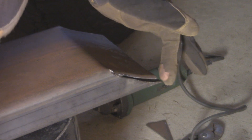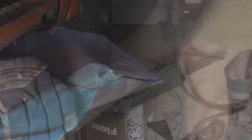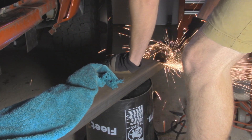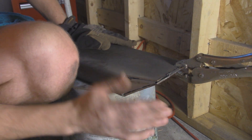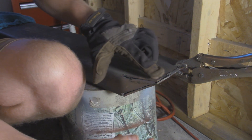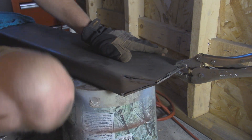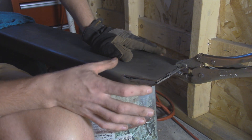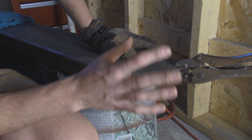Alright, so I got that hammered down most of the way, and we just have a little bit of a lip right here — probably 3/16ths of an inch on this bottom side. So we're going to cut that off flush with the end of here and then we should be able to kind of tack these two pieces together. When I do this one cut over here, it's going to make a couple lines to cut out the top and bottom, and this little corner piece is going to fold in like so. I got this little corner piece kind of notched in — I basically went an inch from the end over here and just kind of cut out this triangle that's on the top, and then went in an inch and cut out the triangle there. Just made a straight line, then I was able to take a hammer and it bends right into place. There are a few gaps, but we'll massage the metal getting this all into place. Just using a vise grips here to kind of hold it — I'm going to tack it all in, then fully weld it, and then I'll take a grinder and smooth out all the welds so it's a nice round shape.